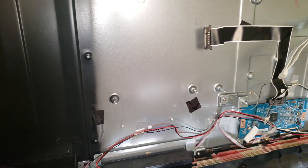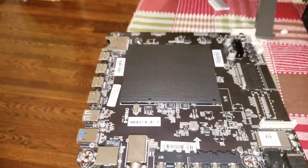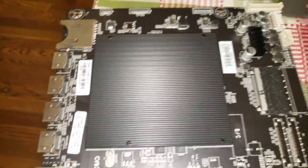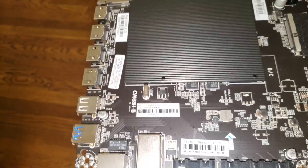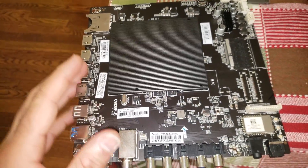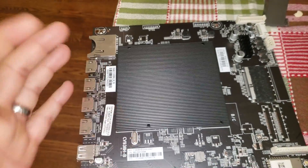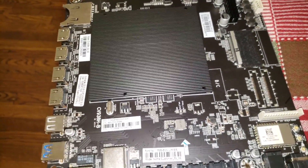I'm changing this board right here, which is the video board. It's been giving me trouble — basically none of the HDMI ports work. You connect the computer with whichever one and you get no video out of the TV. They started off flickering at first and then totally just stopped. I ordered a new board because of this design right here, so I couldn't see which chip needed to be replaced.